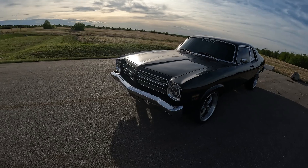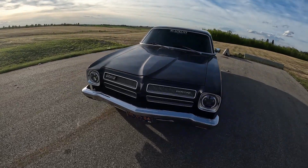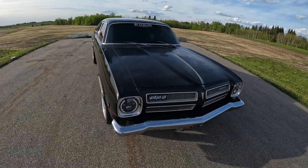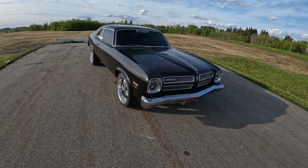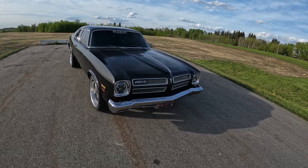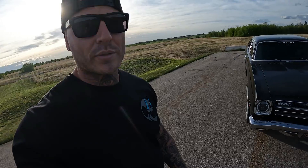Side note — you can see where the carb burn was, carb fire from the backfire on the NOS. Anyway, I did 138-ish. Then I did the 6L LS swap, LQ4 with 799 heads, 4L80E trans with a normal stall at the time. I was still running the 308 gears then. Everyone knows the 4L80E has a tall first gear — I could almost do 100km/h in first gear with the stock setup with 308 gears. Went to 410s, and now my time matched my 400 small block Chevy, which was a 138.